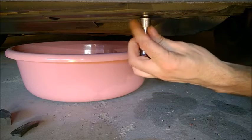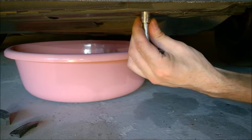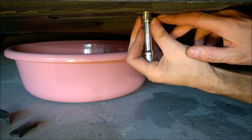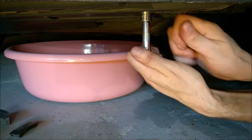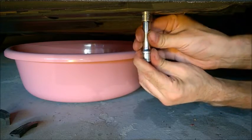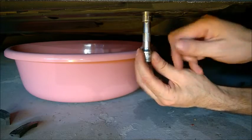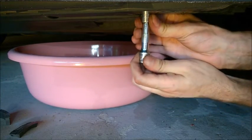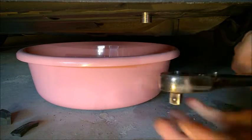A three-inch extension should be plenty enough. Make sure to push the Torx bit all the way in until it's fully seated — you'll notice it disappearing into the hole. Press a little bit if needed. Undo it the right way; mine wasn't really tight and I just do it by hand. It will never leak because it's impossible for it to unscrew, thanks to that rubber seal.